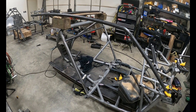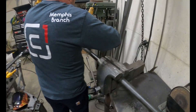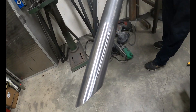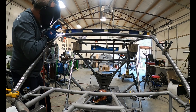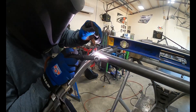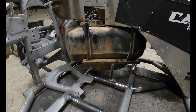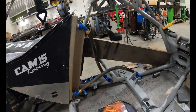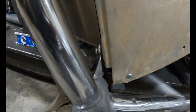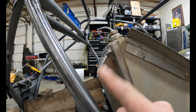I also got our A-to-B tubes, Jamie over here prepping. Getting a little fuel tank mounted and I got all my duct work from the previous car in place to locate the radiator. We've got little tabs for the radiator mount, fixing to tack those in and then I will build my upper mounts.